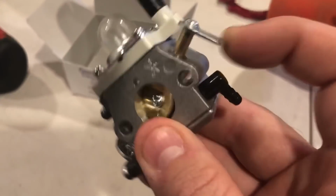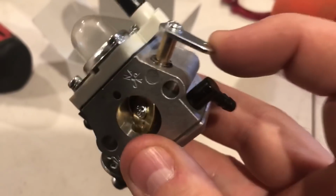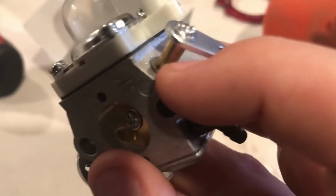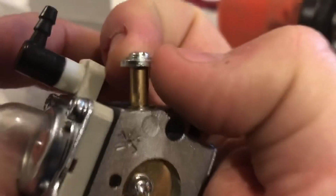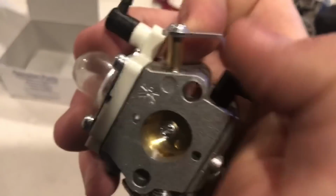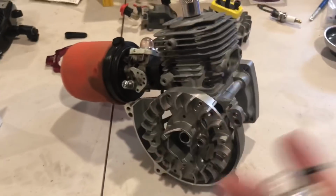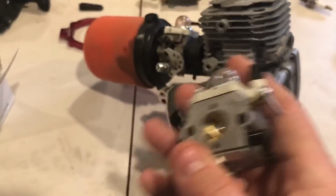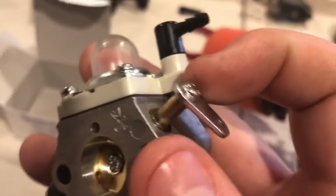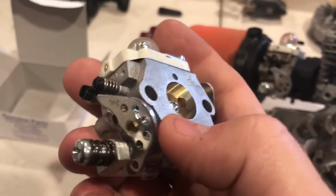When you constantly open and close, and no bearing is there, the regular stock way, little by little it bores. You're going to start having play in there. This shaft will start moving side to side. If you have some play in there, what's going to happen? You're going to have air leaks, like a nitro engine with a pull start. You guys know any gas engine, 2-stroke especially, doesn't like air leaks. The fewer air leaks, the better. You understand? That's the whole point of this bearing and why they call it a modified 990.